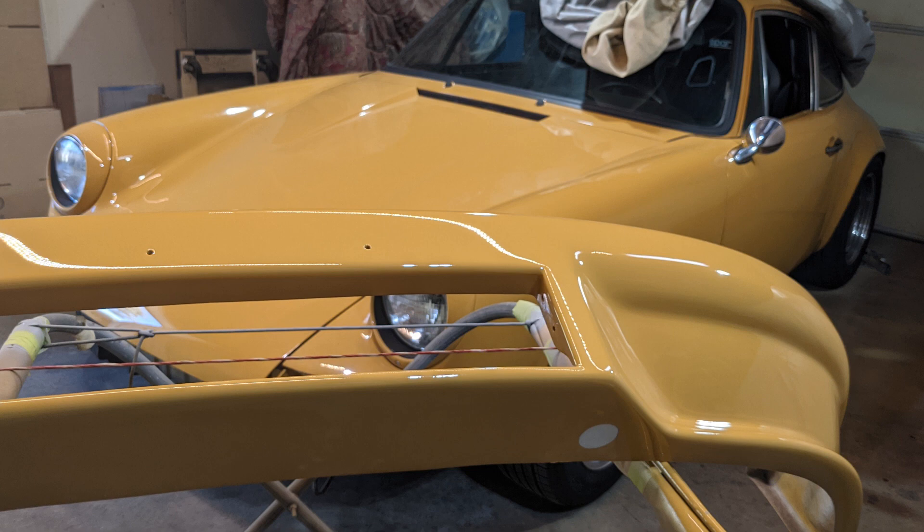I'm pretty confident the paint's going to match. I've already sprayed the headlight rings in my garage after the fact and they matched the body pretty well. Because it's low to the ground, I don't think matching paint multiple months apart will be a horrible issue. I also didn't spray the rear bumpers this time because in this little garage I cannot tolerate any more overspray — I sprayed about a quart of base coat and a little less than a quart of clear. When we painted the entire car, we used almost two gallons of sprayable paint, and you can't do that in a garage without heavy duty exhaust fans. That's why I went to the paint booth and broke it up into smaller pieces.